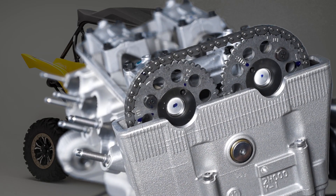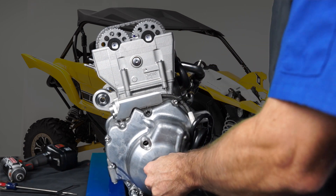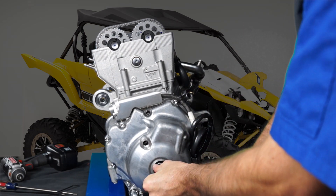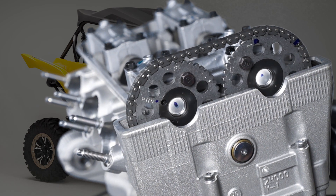As the motor is turned by hand, there will be positions where the camshafts will rotate quickly or jump a small amount due to valve spring pressure on one of the cam lobes. This results in very audible clicking noises from the timing chain tensioner since there's no oil pressure. This is normal, but the chain should stay on the sprockets, indicating the tensioner rod has released.